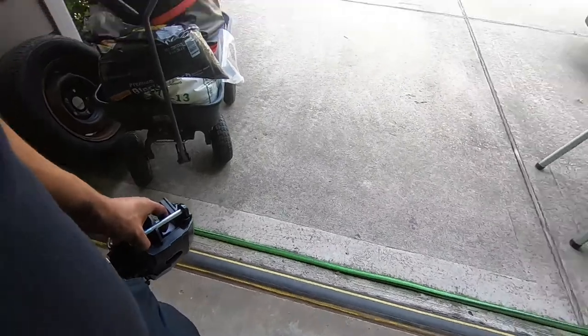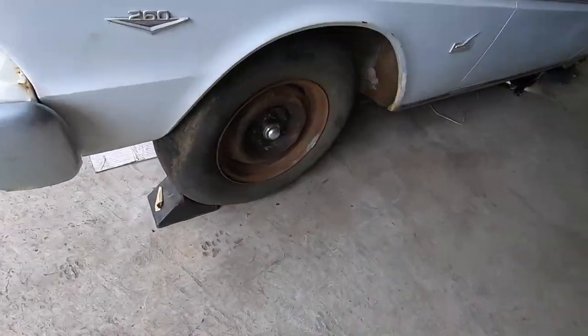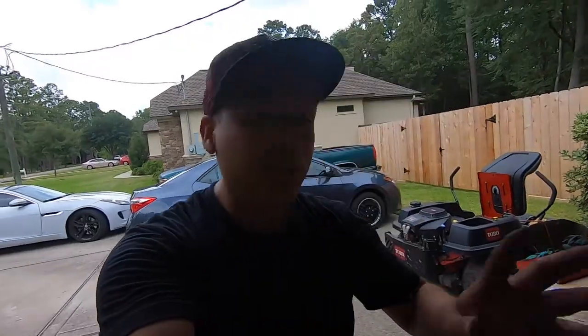The caliper does label left and right so you don't mix them up — that's good. Rotors are on. That just about sums up today's video. I'm sorry we don't have this Ford out and going yet, but I really want this Ford driving. Next up, we have to take care of the wheel situation — the rear brakes don't fit a 14-inch wheel, so we're probably going with a 15-inch rim. Hopefully next video we'll have this Ford up and going. Thank you for watching — definitely consider subscribing so you don't miss the first drive. It's coming so soon!